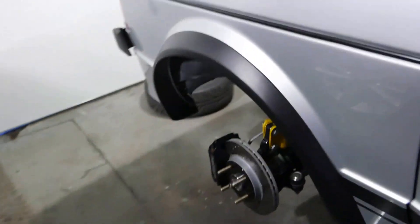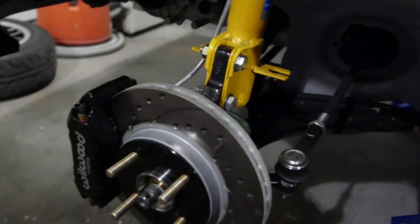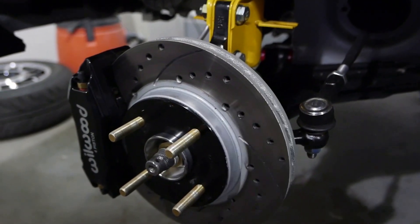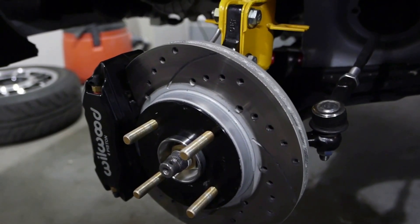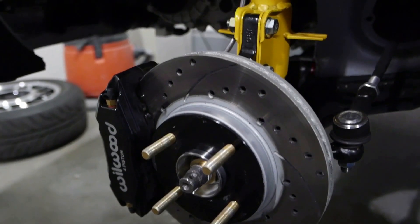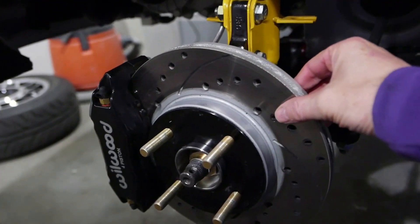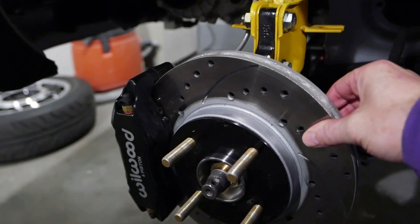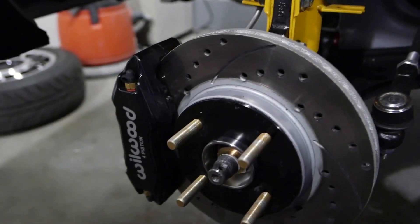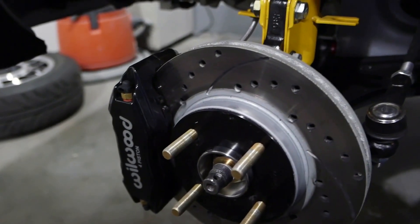Something is off with that — looks like I'll have to change the fuel pump. The brakes are working super well. I love these Tech 53s. I'm definitely going to be able to back off the proportioning valve for the rear and get more pressure to the rears, because these things were warmed up quite hot — probably 600 or 700 degrees during the panic stops — and the rears are barely getting warm. So it's time to start experimenting with adding rear pressure.